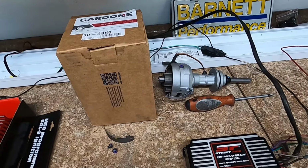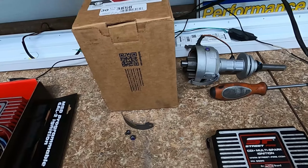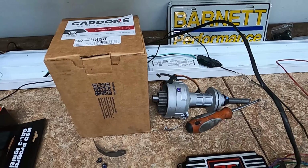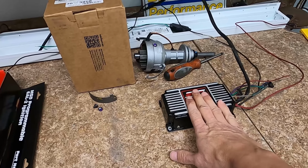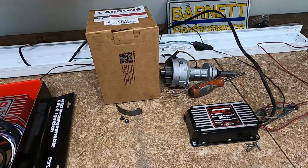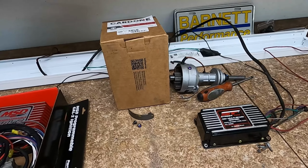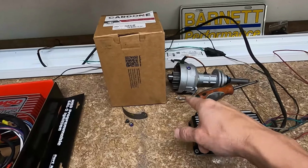I think I paid about $50 for it from Rock Auto, and there's no need to buy an MSD in my opinion, but you do what you want. If you have a mechanical advance distributor and you want to lock it out or limit the timing, which I've done in the red truck with this box, there's a part that 4secondsflat.com makes. It's called a timing limiter. It's a plate that goes in the distributor. I have an old video that I'll put in the description of me installing one on a '70 AAR Cuda. The video is not great, it's a little dark, but you'll be able to figure it out. So that's a good part. I think it's pretty cheap too, maybe 20 bucks, but it just takes a little time to take the distributor apart. Well, I'm going to get started putting that MSD in.